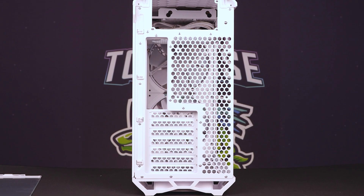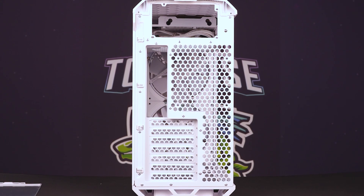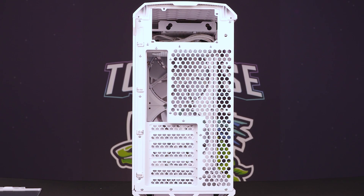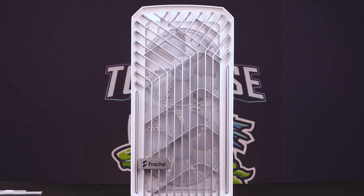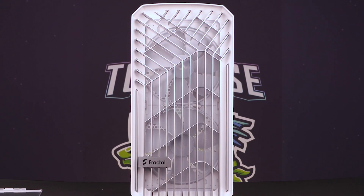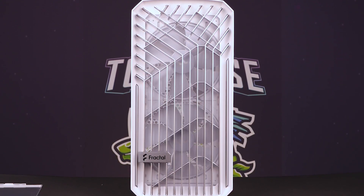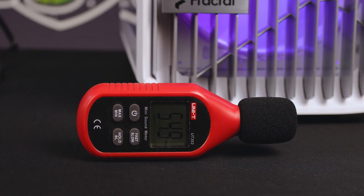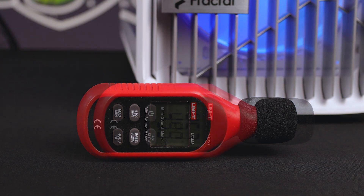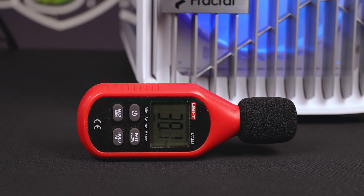You can see this is a bit of a different setup. But for an air-cooled build, it's extremely, extremely good — especially with those two 180s at the front. They are enormous and incredibly thick. They have super good high air pressure and are basically completely open — just mesh and channeling for effect. I'd say it's probably 80% or more clearance up front, so there's almost nothing holding those fans back. They're strong, with about 1,300 RPM max speed observed. As far as noise profile goes, it's actually not too bad — even at full chat there was about 45 to 56 on the sound meter. At 50% they become a quiet hum, and at 25% it's basically completely inaudible, while still giving pretty good airflow through the case.